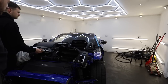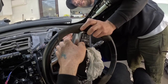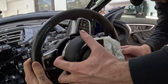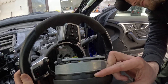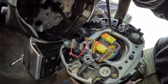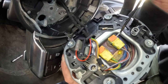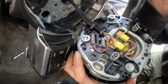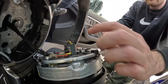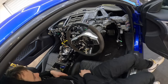Once we were happy that the frames of both dashboards matched up, we could turn our attention to the last airbag which had deployed — the steering wheel one. This was actually really easy to do: two holes in the back of the steering wheel, stick a screwdriver in there, release the spring and it came off the car. The problem was that the plugs had melted to the airbag itself because of how hot the explosion gets when an airbag deploys. Unfortunately, that happened in this case, so I couldn't release the plugs off the airbag with ease — I had to cut the cables. We'll have to replace that section of loom at a later date, but the airbag is off the car.